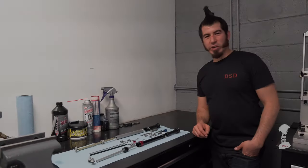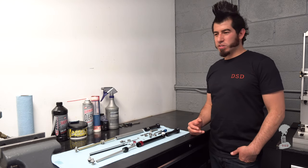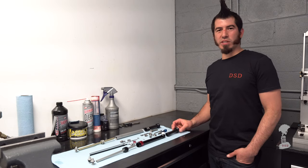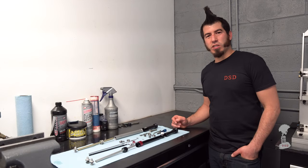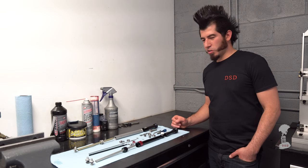Quick recap on Charger 2: once the runt is installed it does such a good job of keeping your fork riding high that we can reduce a lot of the compression damping and give you a much more supple ride. Thanks for watching, guys. If you want to learn more, go to dsuspensiondesign.com — we have more in-depth information on the runt and the damper tunes that we offer.